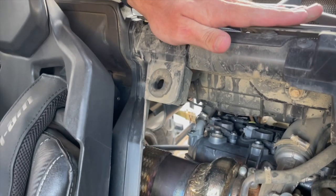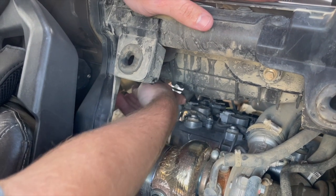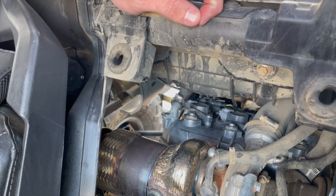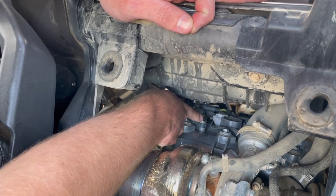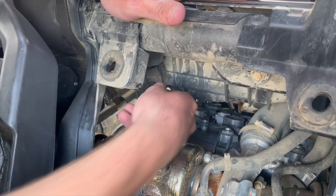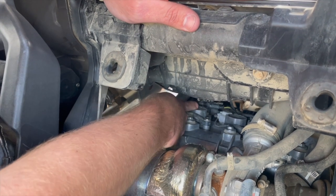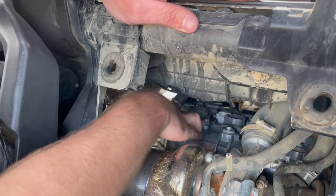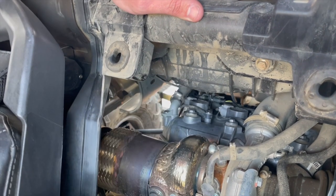There are two ways to do this. If you're agile, you can get inside the tire — from the other side you can just pull the connector off right into the wheel well and get that clip on the wire. If you need a little more room, the ground strap for the connector is secured with a Torx screw. Remove this ground strap and unplug the connector, then go down the wheel well — this lets you pull the connector further out and gives you more room to work. You'll want to install it on the furthest passenger-side coil pack and go through the wheel well.